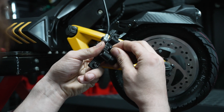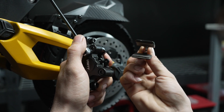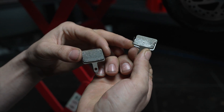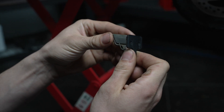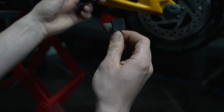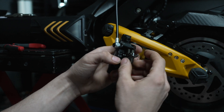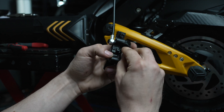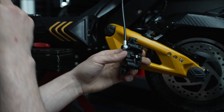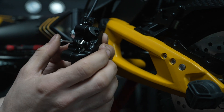Now that that's out, you can go ahead and remove your brake pads, grabbing all three of these pieces at once, making sure the brake pad is on this metal clip here. I'm going to be putting it back into the caliper — squeeze the brake pads together and slide them in. Make sure all five of these holes line up the best you can. Grab your metal tab and slide that back in.